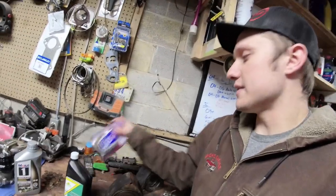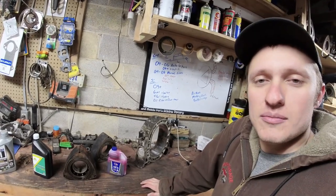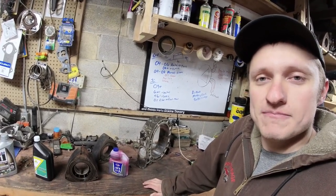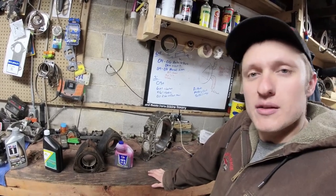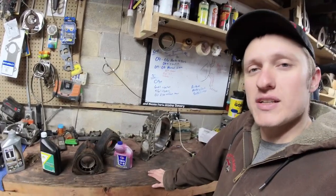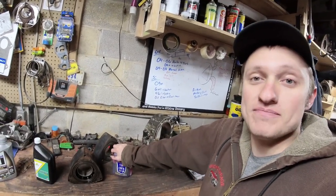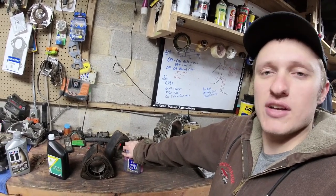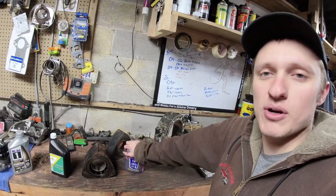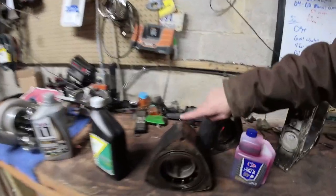So now you're going to ask, should I premix in addition to maintaining the oil metering pump system on my car? Now, I drive my RX-8 sometimes on the street, mostly on the track. My black RX-8 that I had before this one was solely a daily driver. My daily driver RX-8, I didn't premix at all in that car. I'm driving it to Nashville in traffic, sitting with the AC on. It's idling at 1,000 RPM. There's no reason to burden the inside of that engine with all that excess oil, because all it's going to do is foul spark plugs and make my apex seals get stuck in here with all the excessive carbon buildup.